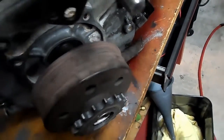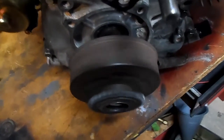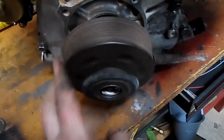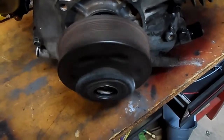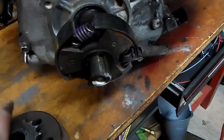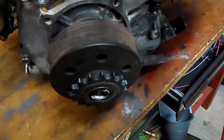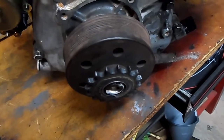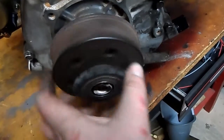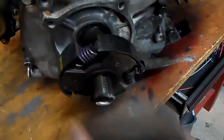The drum will not spin at idle. If the clutch body is locked on the shaft, you could just freewheel the drum — it won't do anything until the RPM raises up. The springs I have in this clutch right now are purple 3400 stall springs, so this won't engage until I bring the engine RPM up to 3400. At that point the clutch will start moving, lock in, and engage.